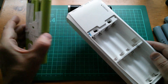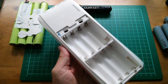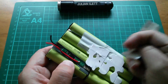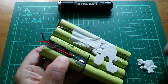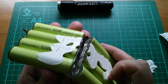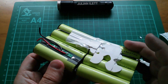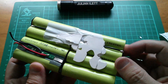But first I've got to get these broken down so I can put them into this Kidean QD188 power bank. Under here was the protection board, so that can come off. I've got to try and get all this gluey silicon stuff off as well. That black wire just links the negatives on this end to the negatives on the other end. The center is all positives, welded along this tab. That's linked to the positives and also the negatives on this end, and that wire links the two negatives.